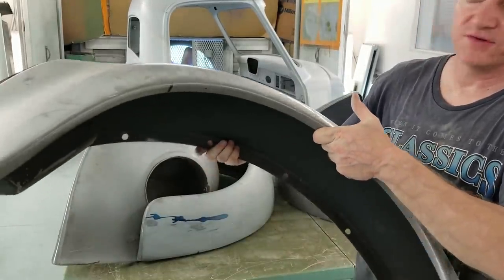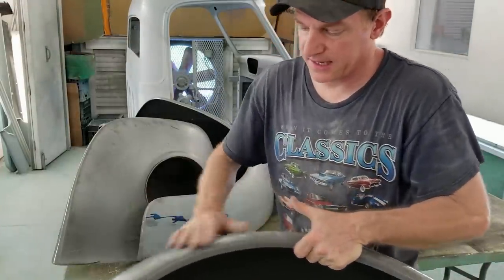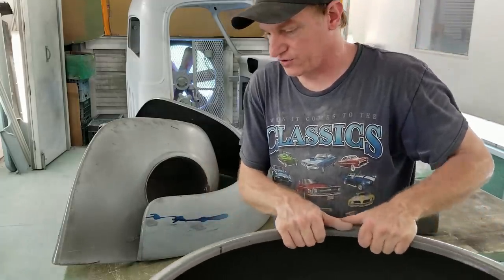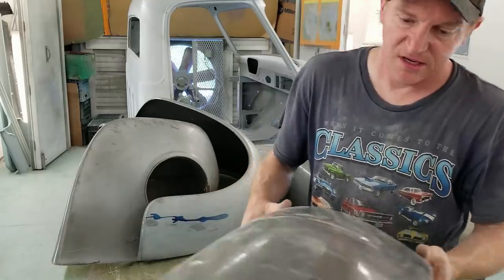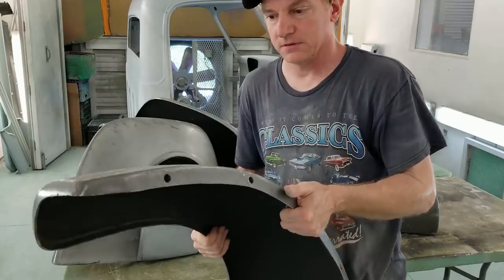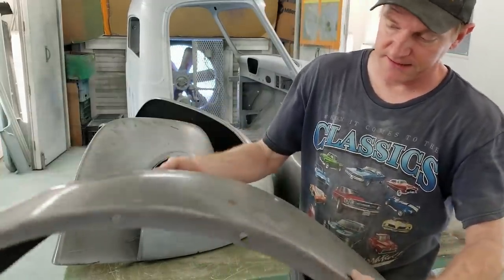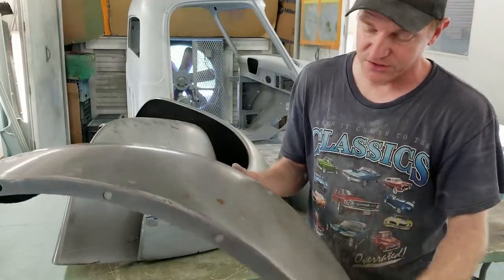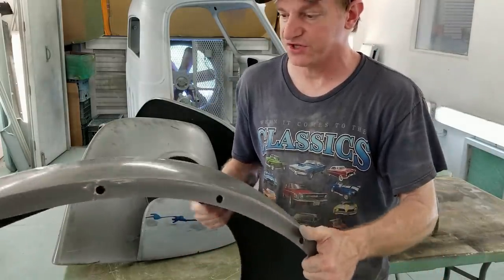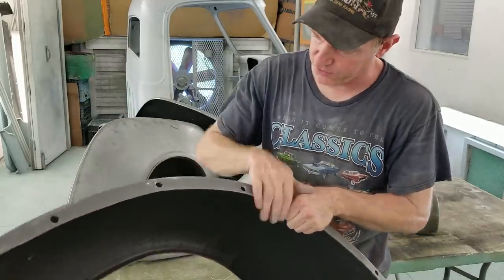We're going to have to start to repair those areas. After we get those areas repaired, then we can do a light sand down, inspect it, and then start putting 2K on and start building off of that. Any other issues we have, we can just lightly glaze them and block them out. I can also use high-build primer — that'll put some strength back in as well. May just do that rather than 2K. 2K does not build structure; 2K is just to flatten or smooth out any little imperfections. It's really not a leveler, although we have abused the product to do that.